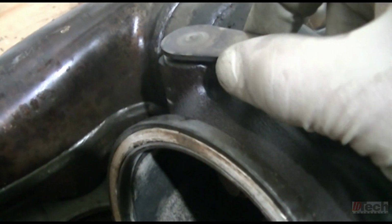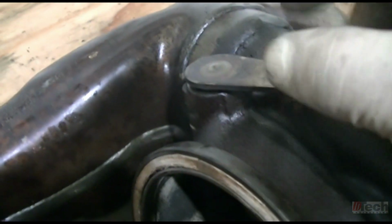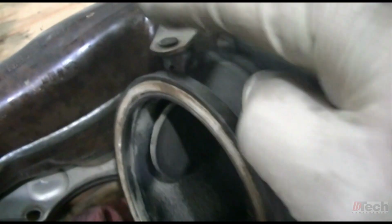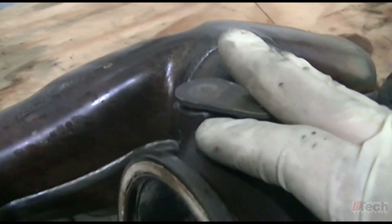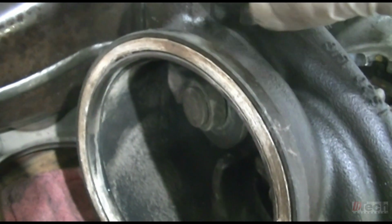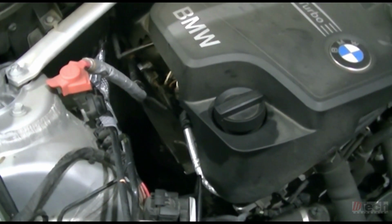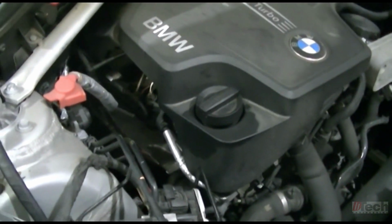Like you can hear and see a little bit of that wobble and wear, and some of it is acceptable. It's once it gets too far gone that you start to have some issues. On the older versions, it would pull in, but it wasn't fully closing this, so you'd have basically a leak and wasn't able to build up boost, so you'd have low boost codes. But it's a theory, an idea, that kind of led me to just check that.